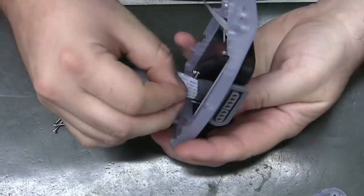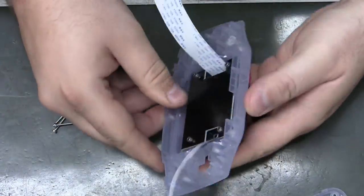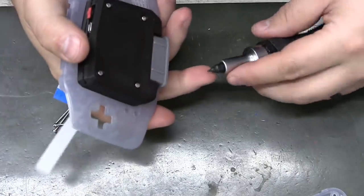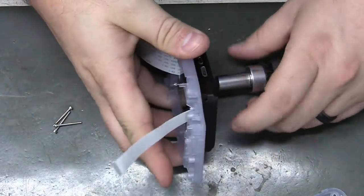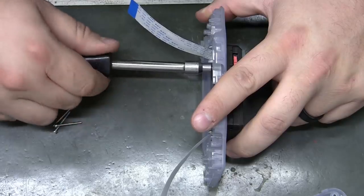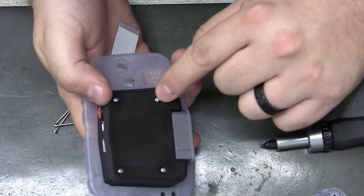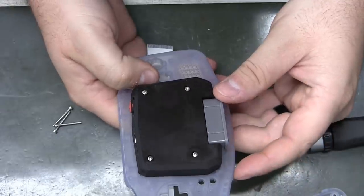See how much more thread sticking through right away. Because this PCB and then the plastic's hitting on that recess, there's no movement here. There's no need to smash it real hard, in my opinion. This is the T7. Kind of works. It's supposed to be a hex, and a 4 millimeter socket. See, there's already almost a millimeter sticking through. That could just be the difference of the head of that fitting down in there into the printed plastic further.